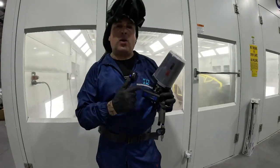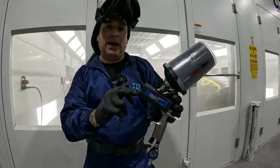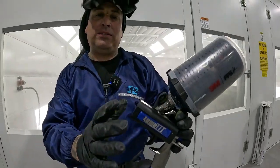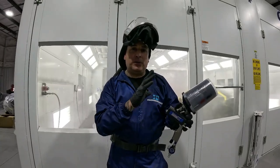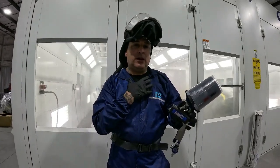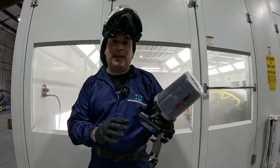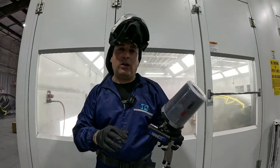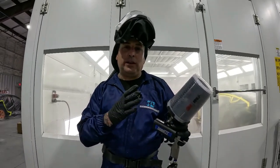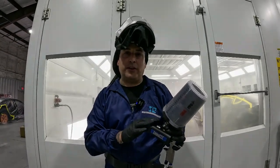All right, so we've got our wet bed on it, and now we're gonna move into our color coat. That's when I'm gonna be using the light. I'm gonna try it out as how I see a lot of guys online spraying with the light while the lights are on, and then I'm gonna show you guys how I do it. That way I know I have coverage, and that way I can really see my metallic and blend it out, especially when you have a trouble color that doesn't cover well, or you have something that you really can't tell whether your blend is perfect. This is gonna be the way to do it, and it's right on the gun.